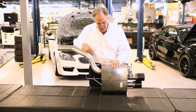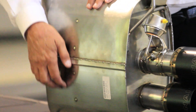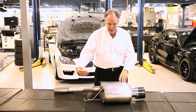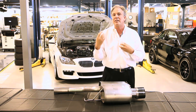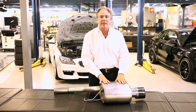In addition, we make what's called the Helmholtz chamber. It's a separate cavity — you can see by the spot welds here — that has a little tube coming out of it, designed to naturally cancel the pulses coming out of the engine. This does not affect flow. If you put a baffle in an exhaust or make the exhaust turn a corner, that hurts flow, but here the pipe goes straight through and this tube comes off the side into a cavity — it just cancels the noise. It doesn't send the exhaust over there, just the noise, so we're not hurting any performance by getting rid of the drone.